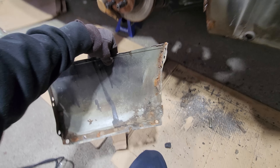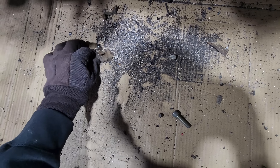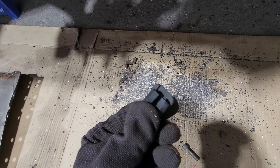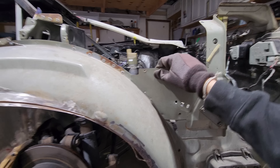Nice. You can see how much dirt was collected inside of here. And this is a rust-free car, I thought. You'd never guess there was rust building up on the inside because of how much junk it holds in there and stores all that moisture. Now there's really no quarter panel left, and my next step is to continue drilling out these pilot holes along here to get the rest of the wheel well off. I might have to take this bracing off as well - we'll cross that bridge when we get there.